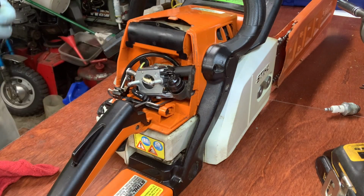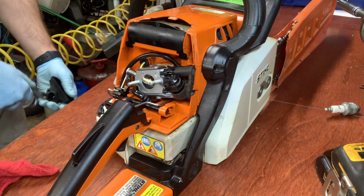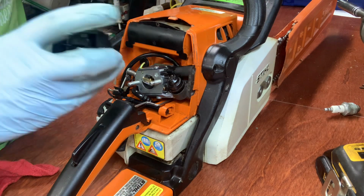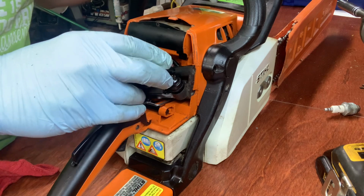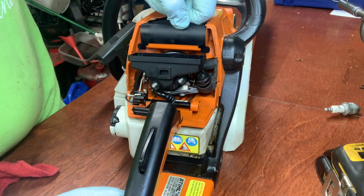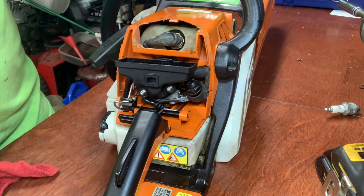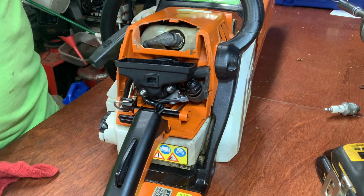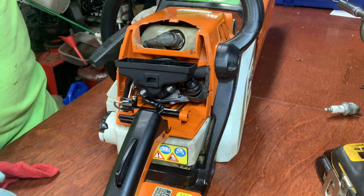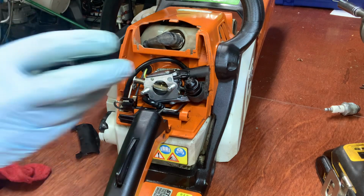And the air box, which is really dirty. For the summertime, you can actually remove this. What's it for? This is because cold air, there's more of it, so you put this in to kind of restrict some airflow. In the summertime, you can take it off.